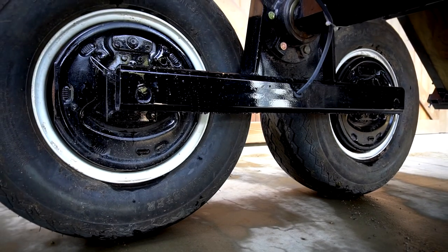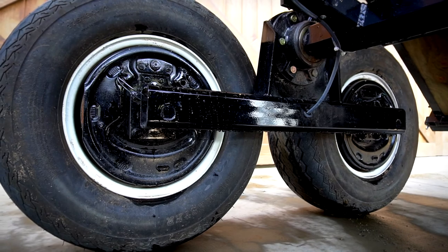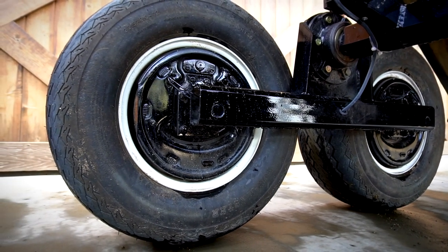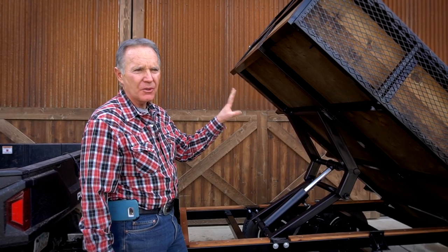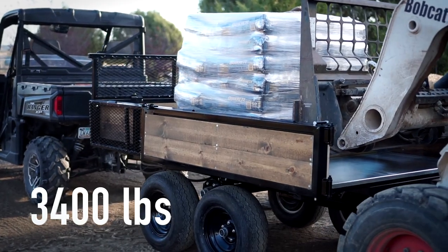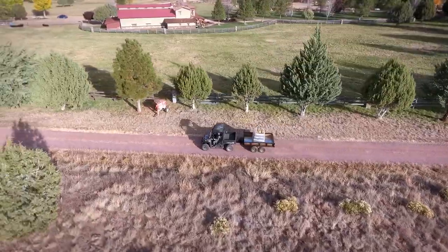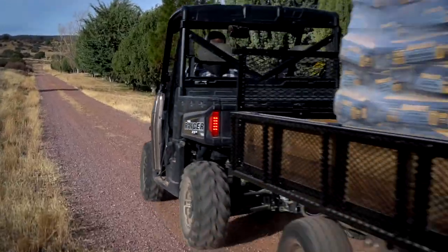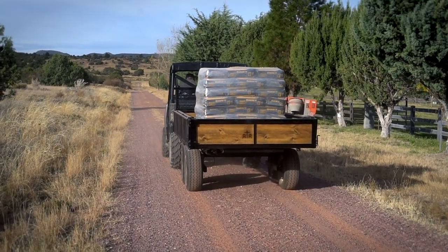So we re-engineered and went to the next size larger brake, and we're putting brakes on all four tires. We feel very comfortable that a loaded, at-capacity trailer will hardly increase the stopping distance over the tow vehicle by itself. Frankly, we can put 3,000 to 4,000 pounds in it, apply the trailer brakes only, and stop the whole rig very quickly.